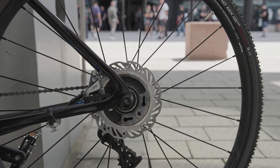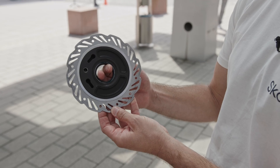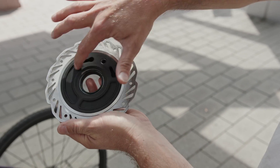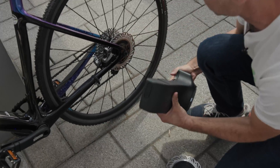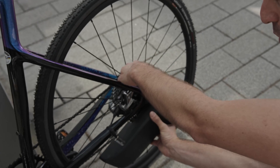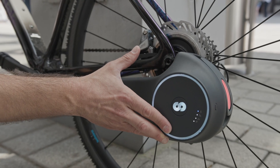The way the disc works: this is a standard disc — the braking surface is the same, the connection is a center lock connection, and we also have a version for six bolts. But inside, there is a floating ring which has a pinion and a circumferential gear. When the unit connects into the system, the unit drives. When it touches the chainstay, it has nowhere to go, so it drives the motor via the disc brake. This is our unique technology.